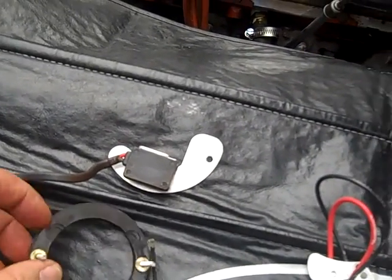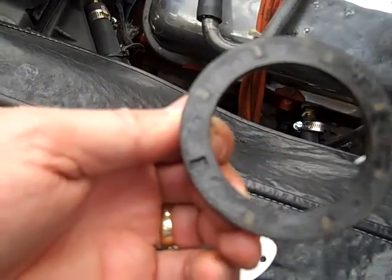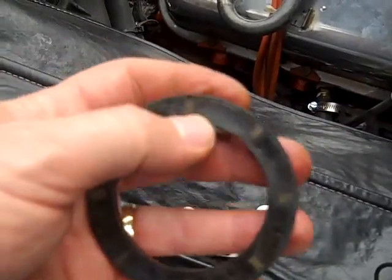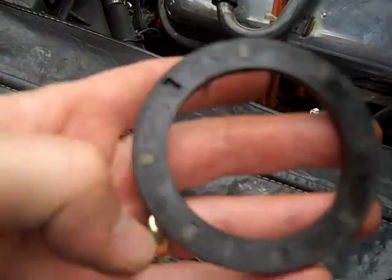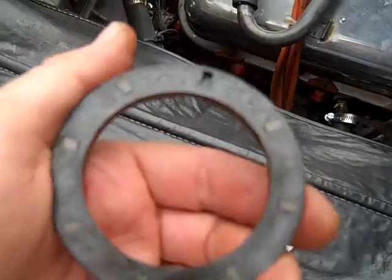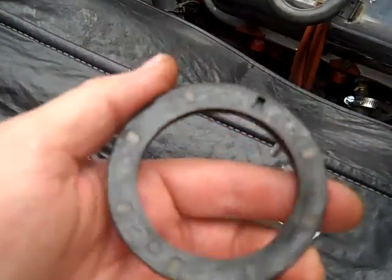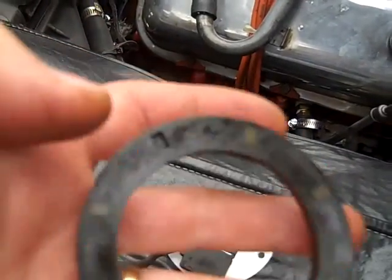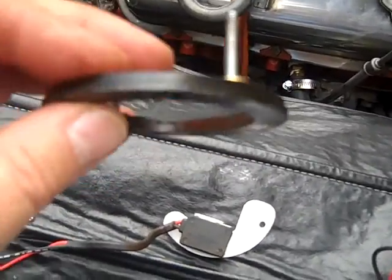I lost a cylinder, and come to find out one of the magnets came out — that's why it dropped a cylinder. There's normally a little plastic strip that's laminated on there that came off too, and then you lose a magnet. The same thing happened to my Buick. So these are kind of a problem after time; it's like they don't use the right glue or they need to use more of an epoxy or more of a sandwich design.